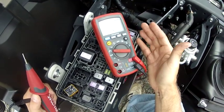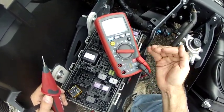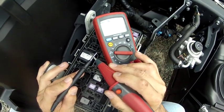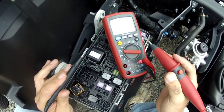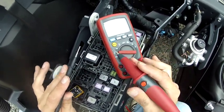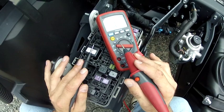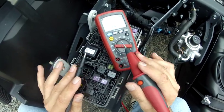The way I use the continuity buzzer more than anything else is to know if something is happening, but not if it's happening right. It's a time thing — is it happening? The continuity buzzer requires that you not only listen for the beep, but also know what the measurement is. I use it largely to know if something is happening, but I don't use it to tell me whether I have good continuity. It tells me if a switch is closing, but not if it's doing it exactly right. Be very careful with the continuity buzzer — don't get lazy and just listen and assume it's good.